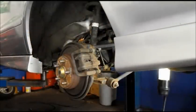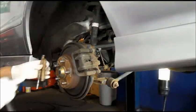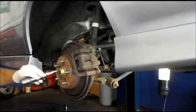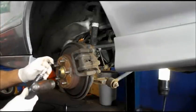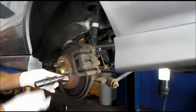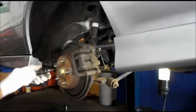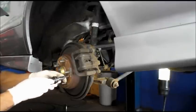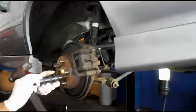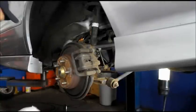First thing we're going to do is use a brass or steel drift to shock these Phillips screws loose. Now, if you can't get them out, they do make a tool called an impact driver — you put it on here and bang it, and it actually rotates the screw out while pushing pressure to the inside of it. I can't believe it — it just unscrewed right out. The second one came right out too. I was really surprised; I thought I was going to have to beat the heck out of it or possibly drill them out. But the impact driver just popped them right out.